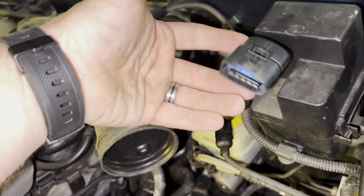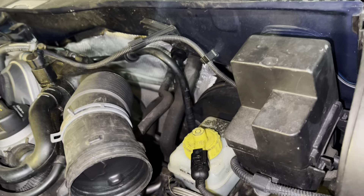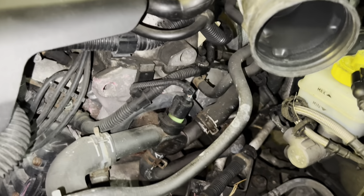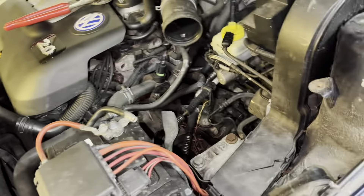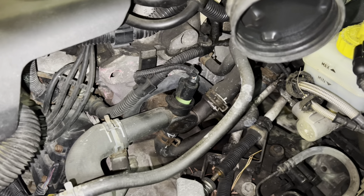You'll also need to disconnect your mass airflow sensor, so we'll just tuck that off to the side. And then we have these hoses here — we can just tuck those off to the side as well. The piece that we're going to be replacing is right here. Like I said, you didn't need to take that breather box out, but this just gives you a whole lot more space to go in through here. Videos I've seen, people don't take that off — but totally up to you, that's what we did.